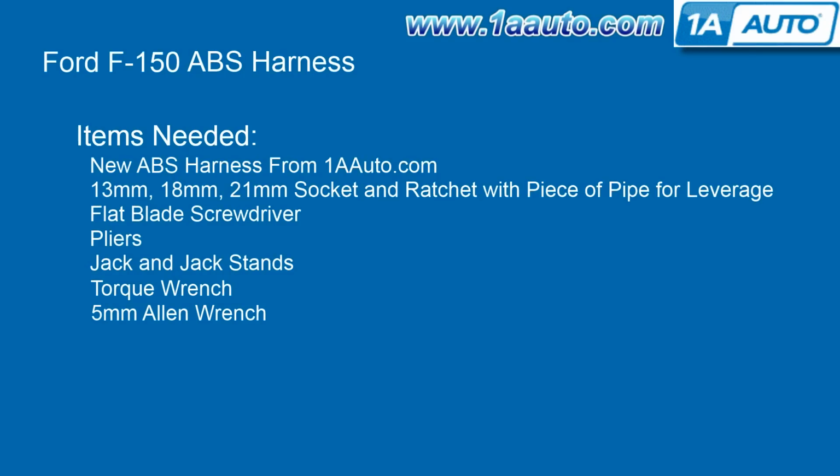The items you'll need for this are a new ABS harness from 1AAuto.com, 13, 18, and 21 millimeter sockets and a ratchet with a piece of pipe for extra leverage, a flat blade screwdriver, pliers, a jack and jack stands, a torque wrench, and a 5 millimeter Allen wrench.